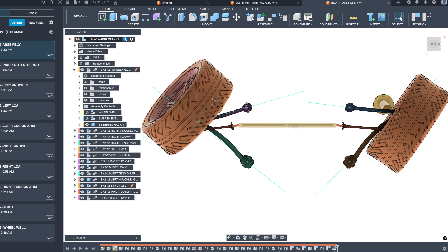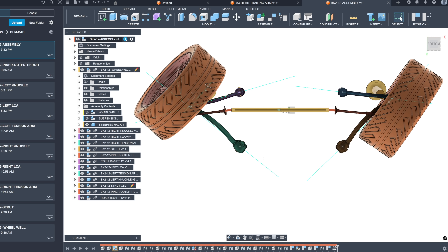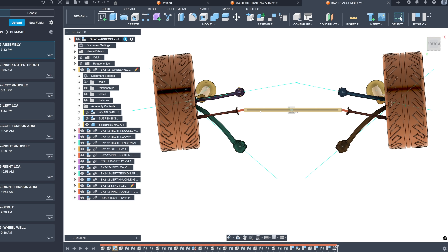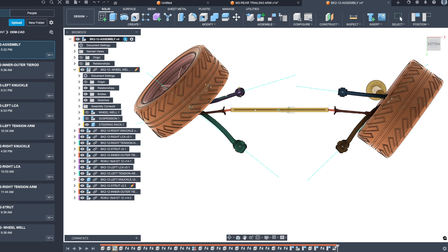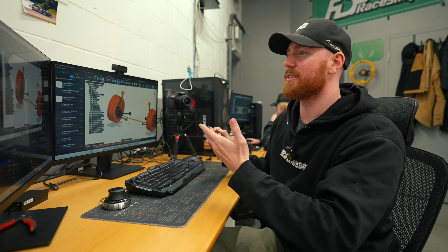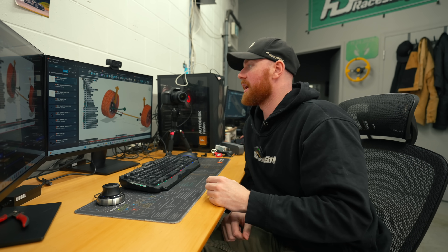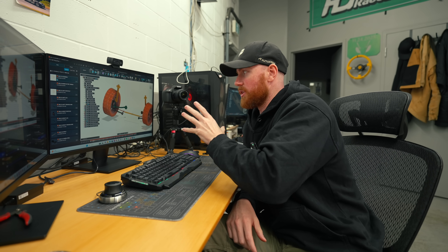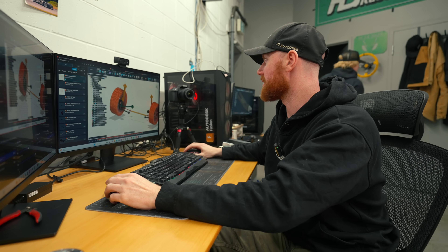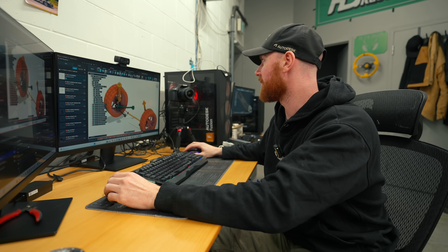From the bottom view, we can see some really interesting things going on with caster and Ackermann. Ackermann is essentially toe at angle, and what all of the scrub radius and dual pivot control arms are doing. The only thing that would be better than this is if we made a front suspension display — just like our rear stuff — that you could actually manipulate and move around. Even though this is really well constrained and visually looks great, we still can't instantly lengthen a control arm and see what kind of changes that has on different things.